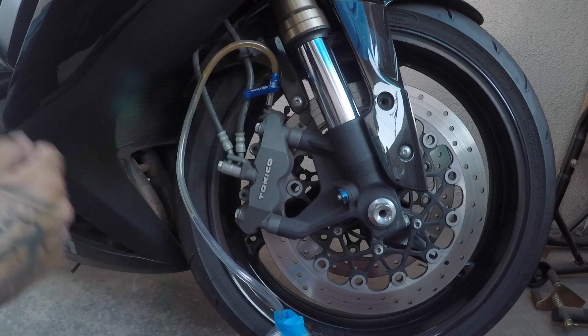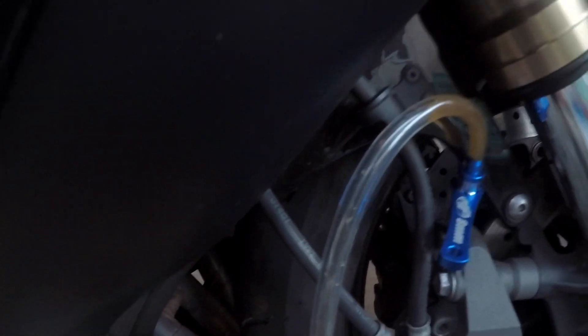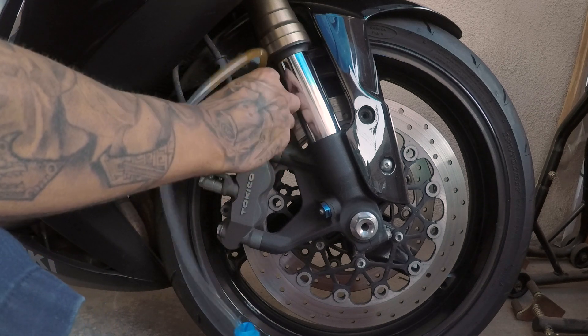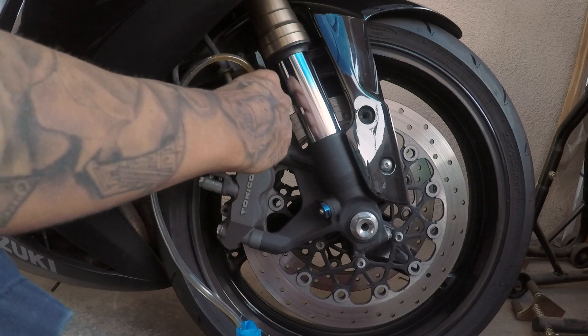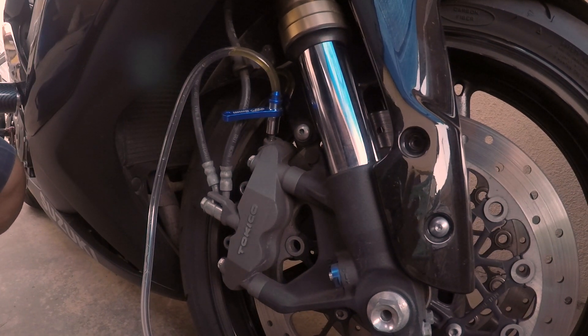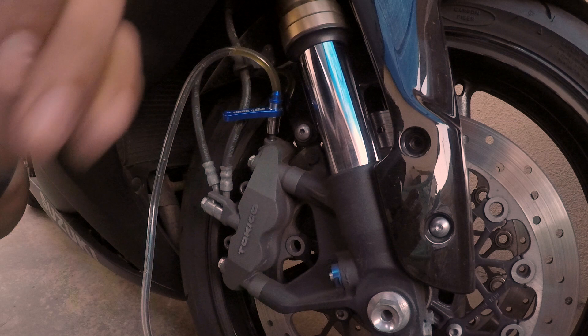Close it when you release the brake — you see how I'm holding it and then let it go. The dirty oil that's still in the brake lines is all going in here. You can see the oil is getting a little bit more clear. Keep pumping your brakes until you start seeing the clear brake fluid come out, then you can stop, re-tighten it, and close your cap.